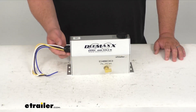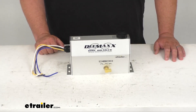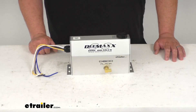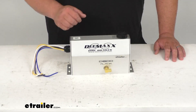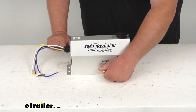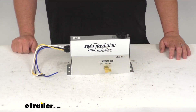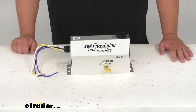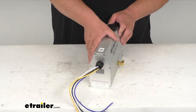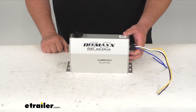It has a very powerful DC motor in here — obviously that's hidden so you can't see it. It is a German-made pump and it installs on your trailer frame or maybe in an enclosed compartment somewhere. It does have a rotating 360-degree brake line fitting here that's included, and that'll allow you to mount it in any position — a very nice feature. That is a brass fitting, so it's ideal for marine trailers. The whole thing meets your DOT specifications. The other side looks pretty much the same, except it doesn't have that rotating valve on it.